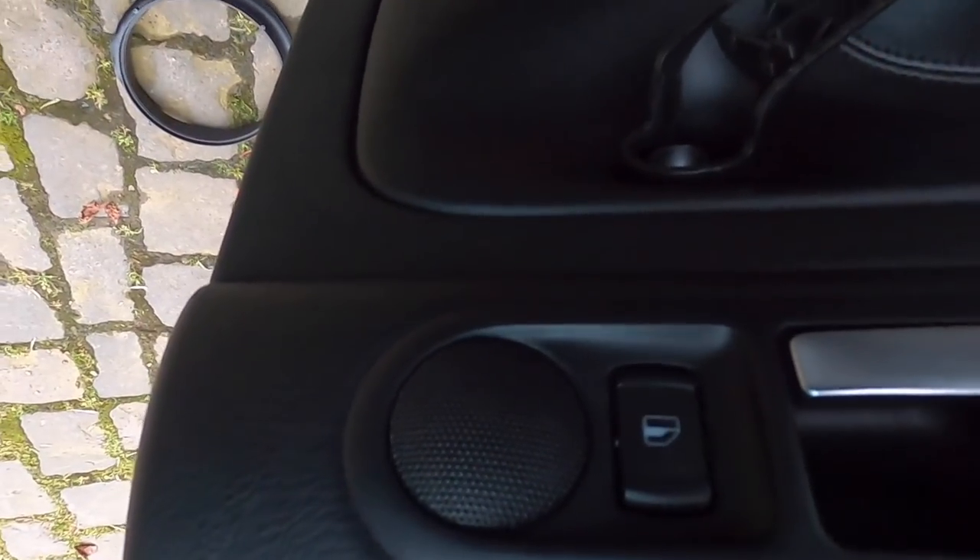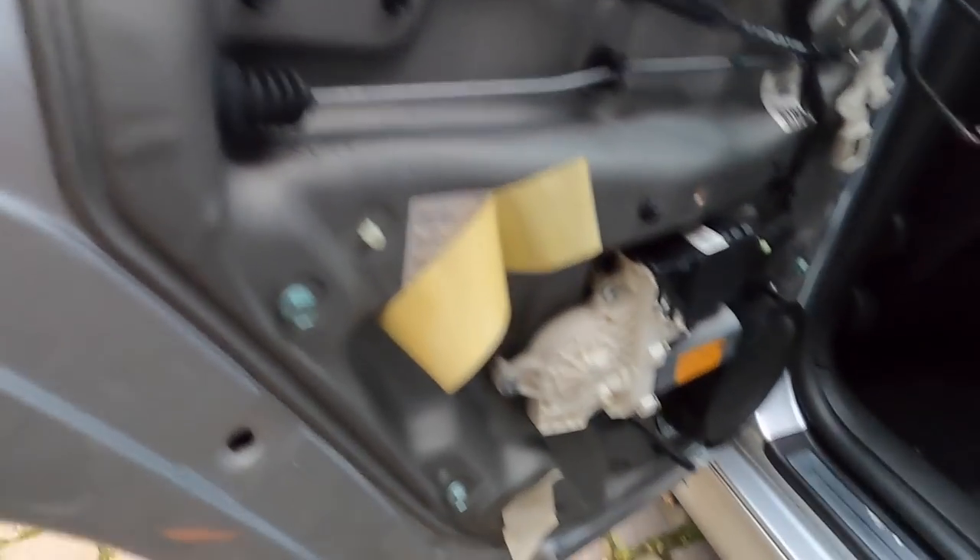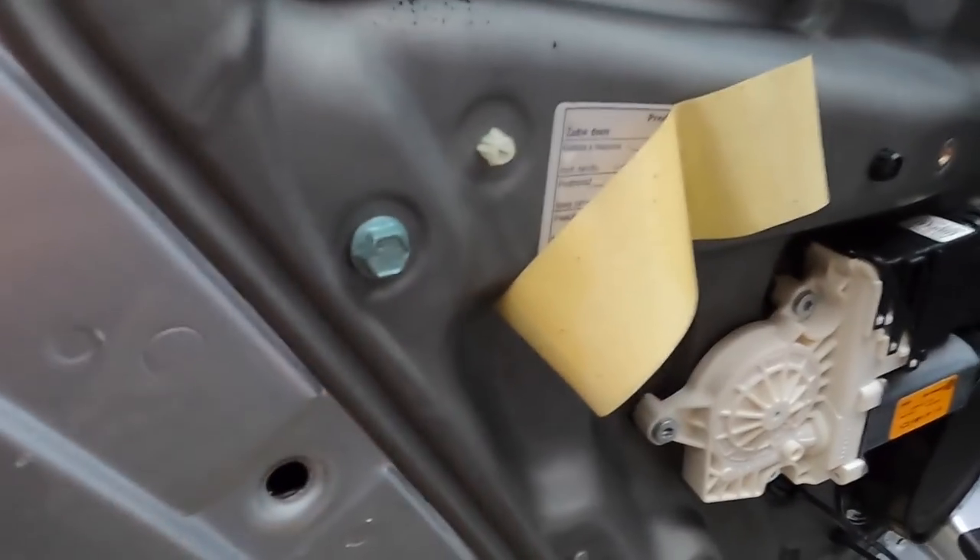We only have one hairstyle, okay? The beanie was suffocating me, making my hair in my face — it's this or nothing. Now that I feel normal, let's get back to work. In order to remove this cable for the door handle, you really just have to lift it out of this little clip that it's in, and then also just lift that plastic piece covering the hook up and out of the little carrier. And then just unplug the little plugs for the tiny baby speaker right here.